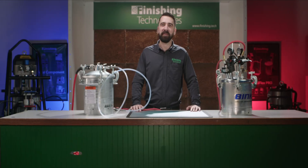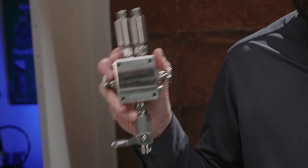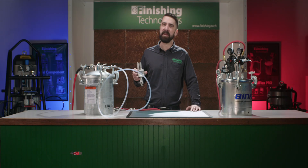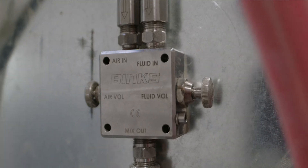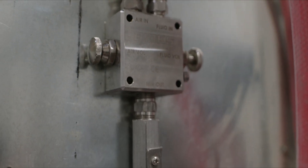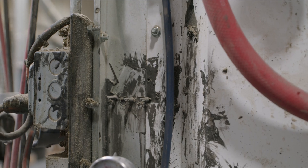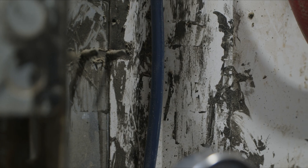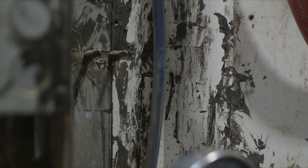Another way you can introduce this turbulent flow to flush out your paint lines is to have this gizmo permanently installed in your paint booth, where easy access is always at hand for cleaning out your paint lines. Feed the system with the appropriate solvent with, say, a diaphragm pump, then connect your shop air, and you have the labor and solvent reducing convenience of the air-chop cleaning method available at any time without the pressure tank setup. This unit is fitted with all the controls and connections for a simple swap that's ready to go whenever you are.